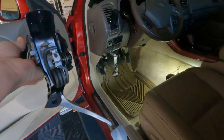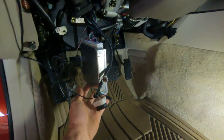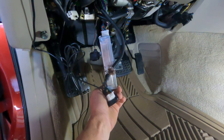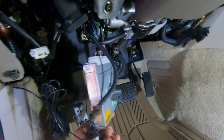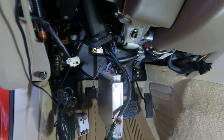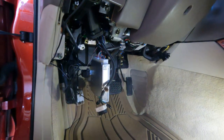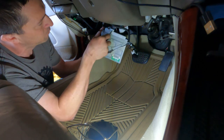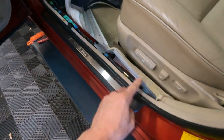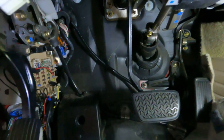This thing is going to mount inside of there. What you need to do is take off your panels. I've already removed this VSC ABS ECU from its brackets — two 10 millimeter fasteners up inside of there. You need to unplug this and all of these right here, and then this thing's just going to drop out. Then we'll have much more room to work with. Remove your sill so you can peel back your carpet — you need to get yourself as much room in here as you possibly can.